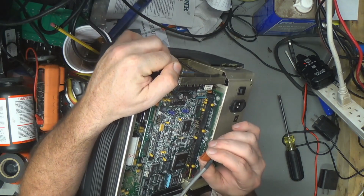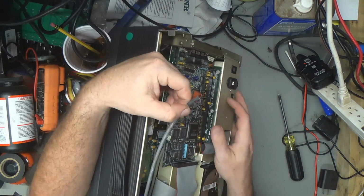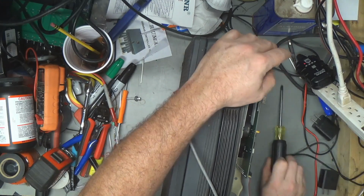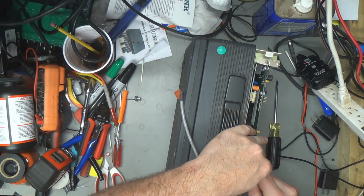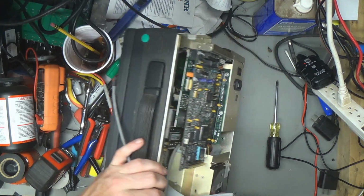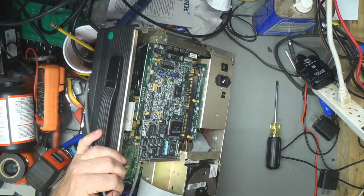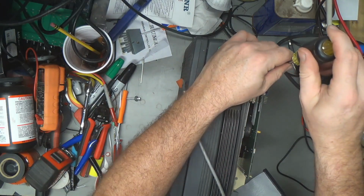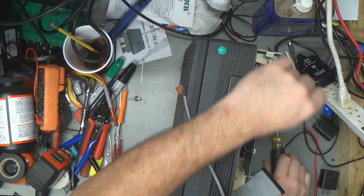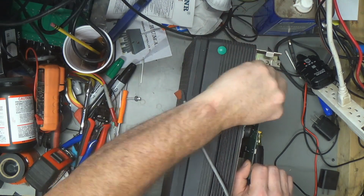For future reference, putting it back together, the blue wire goes to pin 1, although that'll probably be pretty obvious the way that the wire is bent when it's time to do that, assuming it even goes back in. And this big boy needs to come out of here. Why is this big fat 50-pin cable here? Yeah, that's a 50-pin cable. Is that SCSI on the sound card? I'll have to look that card up. That could be potentially very useful in the ProLinea. Unless this thing becomes my main 486 class machine. We shall see. Oh, unplug that cable that goes to the internal speakers.